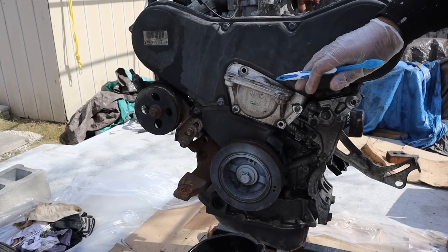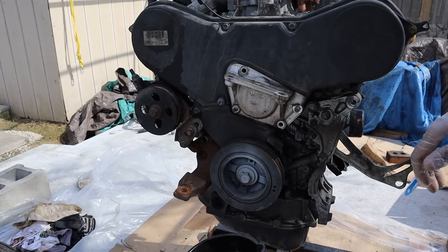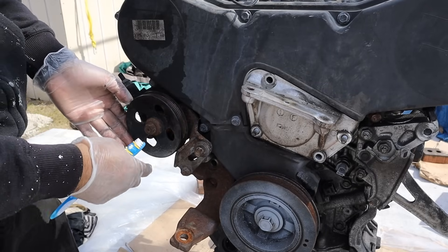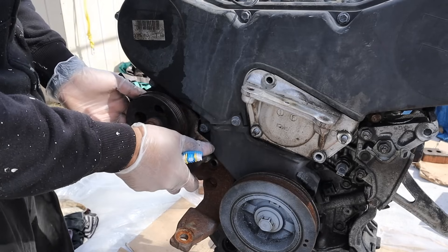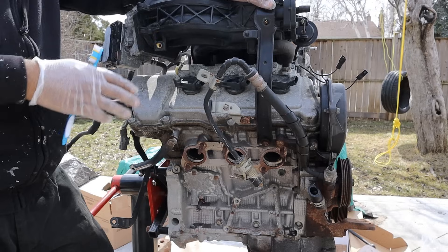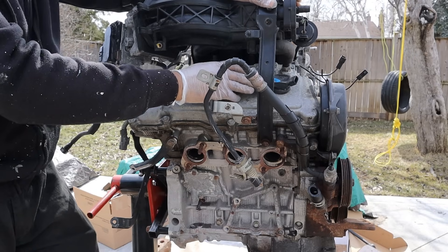Starting at the front of the engine, which is actually on the passenger side of the vehicle, making things a little tight to access. Underneath this plastic cover we have a timing belt. One of the real bad placements for this engine is the power steering pump — you've got the firewall at the back and the fender over here, so it's actually really difficult to get to. Coming around the back, remember the firewall is right up against the engine, and you actually have to remove the intake manifold in order to get these three rear spark plugs out to change them.